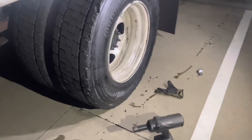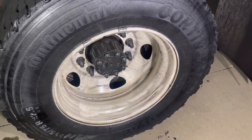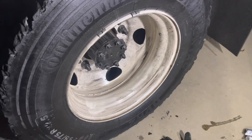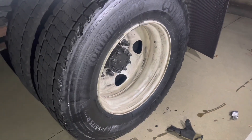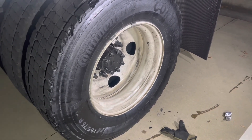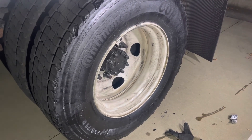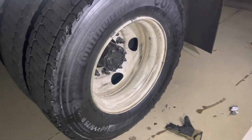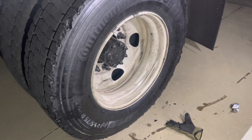We'll call that a job well done. I didn't get paid to detail this vehicle, so I just wiped up the excess oil, got it filled back up with hub oil, and got those nuts torqued down to 70 foot-pounds. On these F650 and F750 trucks — especially the 2020s to 2023s — you have to release that parking brake and put the truck in neutral to be able to pull these axle shafts out. So went ahead and pulled that parking brake back up and threw the truck back in park.